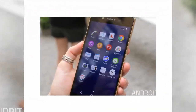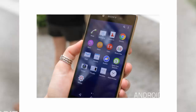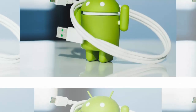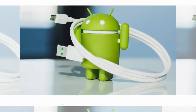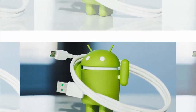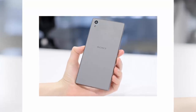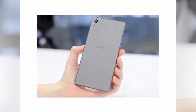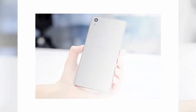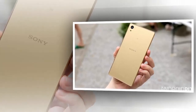Some Sony Xperia Z5 owners have noted a drop in audio quality during phone calls, which can sometimes be resolved by adjusting sound enhancement features. Before you adjust the audio settings, though, try restarting the Sony Xperia Z5 to see if that solves the problem. On top of that, check your network signal strength and ensure your hand or screen protector isn't accidentally covering the microphone or speaker. To set the call audio equalizer to normal, head to Settings > Call > Equalizer. From there, tap Normal and then see if you notice any changes in quality.